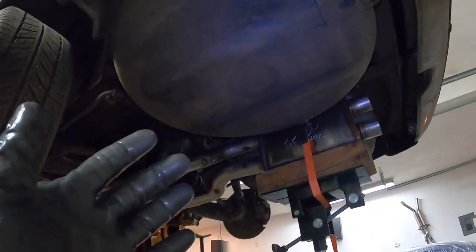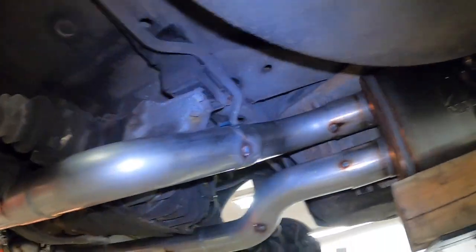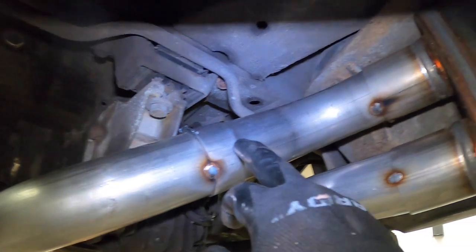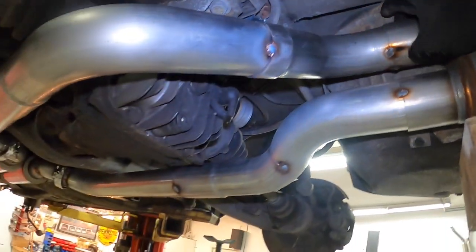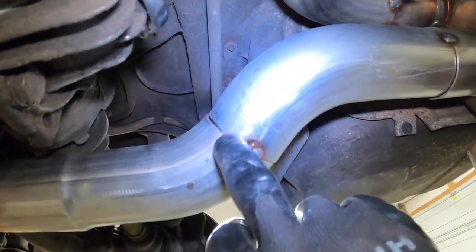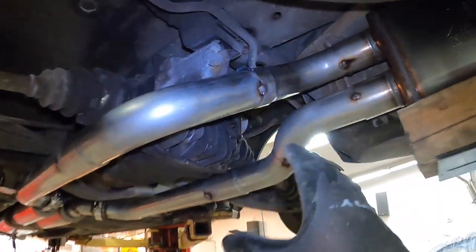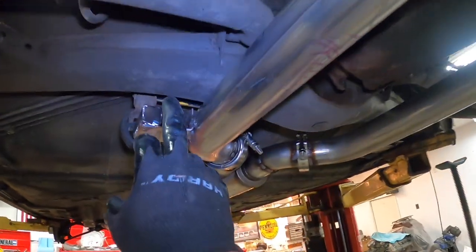Let's sit back and admire for just a quick second. We have now connected both pipes to the inputs of the muffler. This is a slip joint here — this pipe is actually inside of this pipe, and this pipe is inside of the muffler; the outer diameter is just slightly larger. This here is a butt joint — they're just basically two exact diameters put together, but when we weld this all up you really won't notice any difference between the two types of joints.